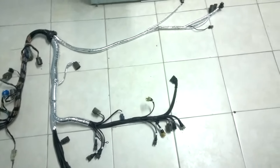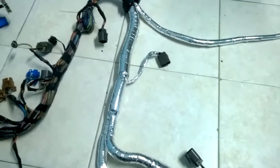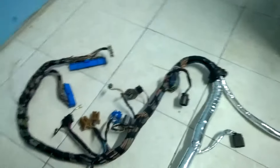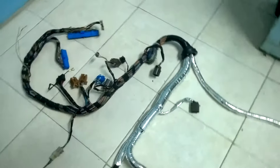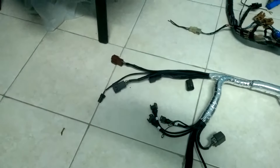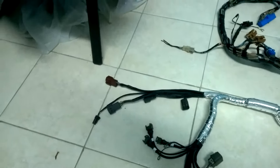You could obviously see the difference — this one is heat wrapped. It's heat wrapped so you get additional protection from the heat of the engine. When you run a lot of boost and so on, a lot of heat is going to be produced and the harness could get brittle a bit faster, so this is additional protection.